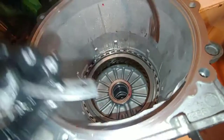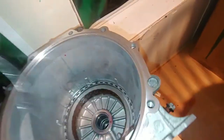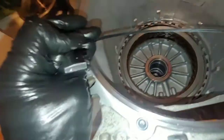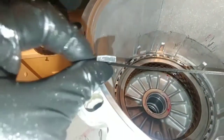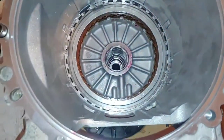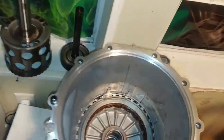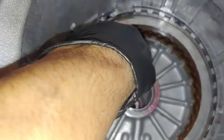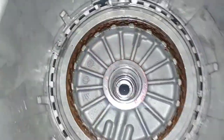This is going to point back in. One thing that is important — this snap ring has a bevel on it. If you look right there, you can see it. That bevel has to go to the top. Also, before you install it, make sure that the groove for the snap ring, the bottom of it, is flush with the top of your center support. If it's not, then your center support is not all the way down where it needs to be. Snap ring is in — using just big long needle nose and a big flat head, I was able to finagle it in there. Always remember: keep the bevel up, and never put your fingers in there where they're going to get pinched. Or they will.